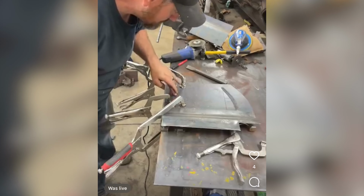So once I got that done, I was able to get the panel in here, tweak it a little bit, and weld it into place. Once I got it into place, I figured out roughly where I wanted this steering column using a piece of exhaust tubing. Turns out I was a little bit high on my reference, and I'm still a bit high. I'm actually hitting the booster here now. So I'll bring you in and show you what's going on here.